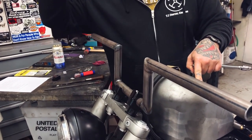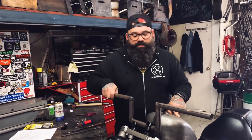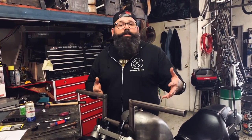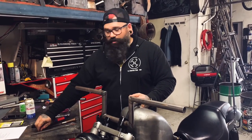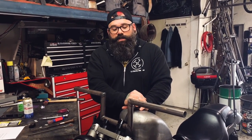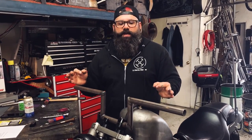This is technically number 11 on my list, but it's my number one five-star method combined with using Loctite on your bolts to keep your handlebars from flexing. Personally, I've never really had any problems with my handlebars flexing using these two methods. In my personal opinion, using good red Loctite on those riser bolts and clamping down the rear of the riser first and then the front is going to be your ideal way to keep your bars from moving.